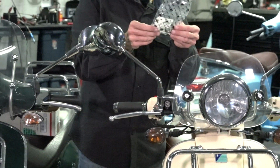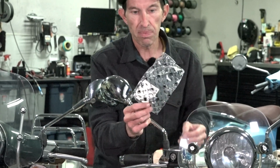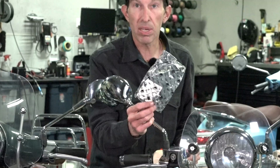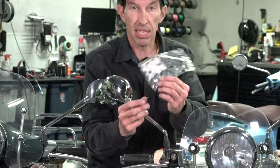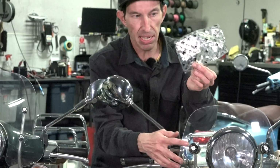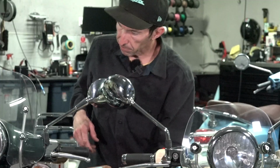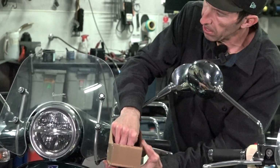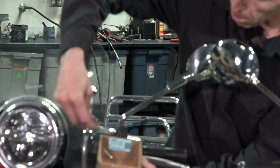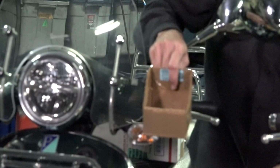If you're looking for the large button, I would say it's a little over an inch, inch and a quarter. Part number is 562366 for the replacement chrome button. They're plastic chrome, so if you over tighten the screw, they will crack. If you're looking for the smaller button, part number is 599620, and these are the replacement small buttons. You see there's a little bit of corrosion on these, so maybe that's a reason you want to replace those buttons.